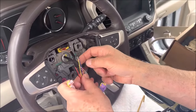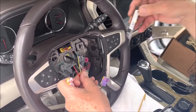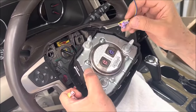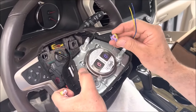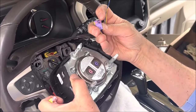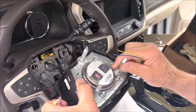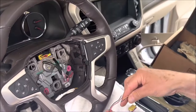So what I did — I ordered two new leads. I'll take this loose, solder these together very well, and then use some heat shrink tubing, put it right on top. You'll notice you've got pink and you've got purple. These are not all the same — I ordered two sets. The little inset prong is in different positions on each set; the other set doesn't fit. These fit. So it'll snap right on there after it's soldered in.